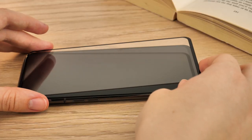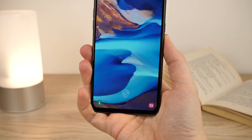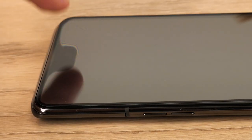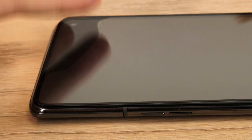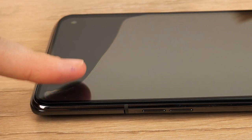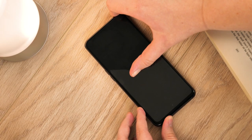Start by resting the top of the protector onto the screen. You'll recognise which end of the protector sits on the bottom by the slightly thicker black border. Press your finger lightly onto the surface at the top and watch the glue begin to spread to the bottom of the screen as you slowly lower the protector onto the surface. You can use your finger to gently help the protector stick into place, while pushing away any potential bubbles in the process.